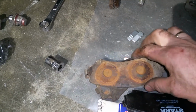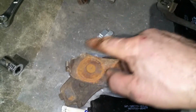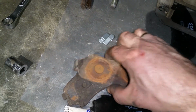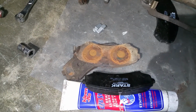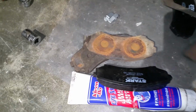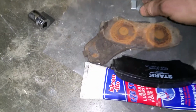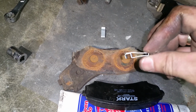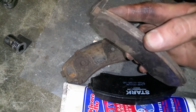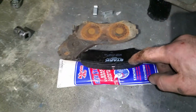You can see the pad that was installed against the caliper pistons. You see the marks from the pistons. It has this tab, so you could take a couple of pictures before you take things apart. It makes your life easier when you put stuff back. Or look in the manual, look into the car manual. But again, you have to use on each wheel one of these tabs. Okay, so just copy your disassembly procedure and don't forget to put this thing back on the new pad.